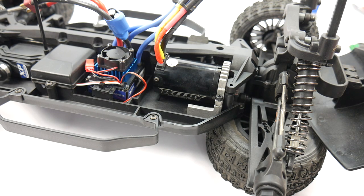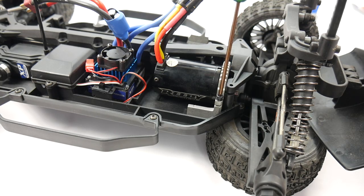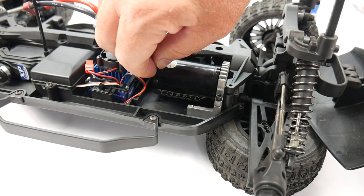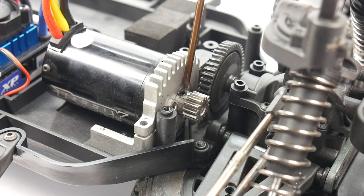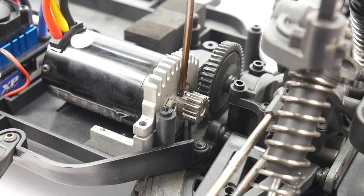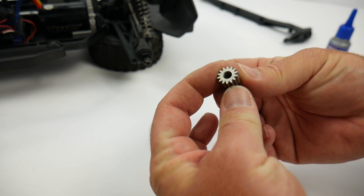On the Pro Rally, it's pretty easy to change out your pinion gear — you don't even have to do a lot of screw turning. It's just a matter of taking out this one screw and then removing the pinion gear. The Pro Rally operates on a cam-style motor mount, which once you loosen this screw, allows the motor to swivel back and forth, creating the perfect gear mesh from your pinion up to your spur gear. I went ahead and took out the top plate so we can see everything clearly. Let's go ahead and remove the stock pinion gear — I'll insert my 2 millimeter hex driver and give a quick turn on the set screw. Easy as that, and it just slides right off the motor shaft. We can now confirm it is a 32-pitch gear with a 5 millimeter shaft — a 14-tooth pinion that came stock.